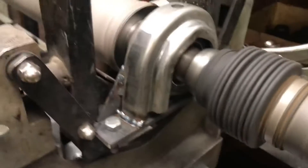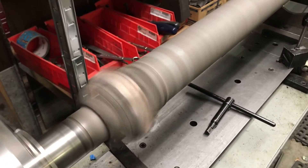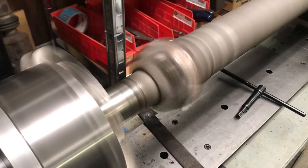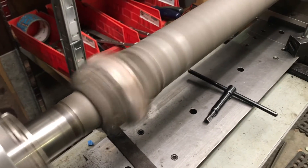I created a heavy duty center bearing for him out of a 211-175X Spicer. He had complaints of the cheesy OE center bearing with repeated failures. I put AAM joints in it — these 50s Dodge shafts with the AAM joints are the best; they're pretty damn good quality joints too.